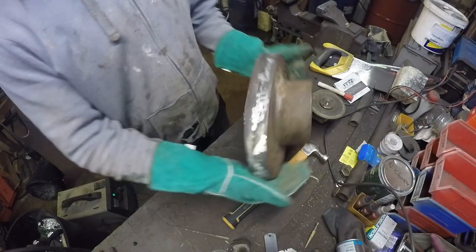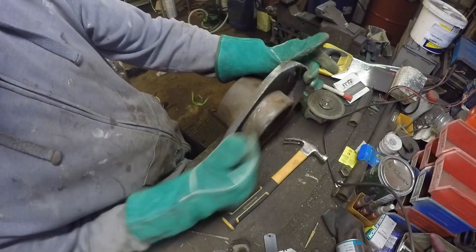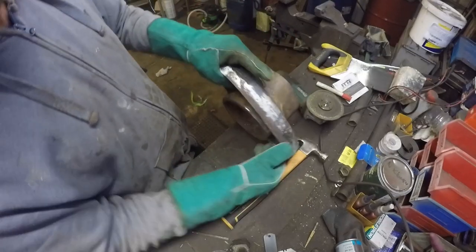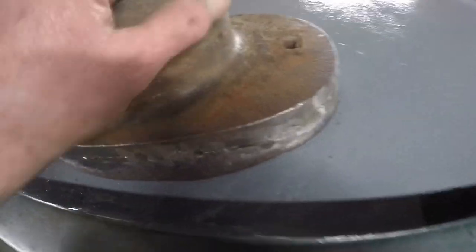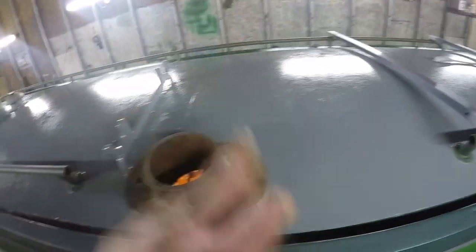So this is where I am so far. I've got that piece there - it's all going to need a little bit of a grind and a tickle. I'm going to put it on the roof and scribe it up so I can get it nice around here. Bearing in mind it'll have a beaded seal around it anyway, should be lovely once it's all painted. Look at that - gorgeous! Just a tiny bit of a gap round here, but it's fine. Bit of sealant to cover that up and that'll be nice and watertight. Can't do anything more with this roof now because it's wet.